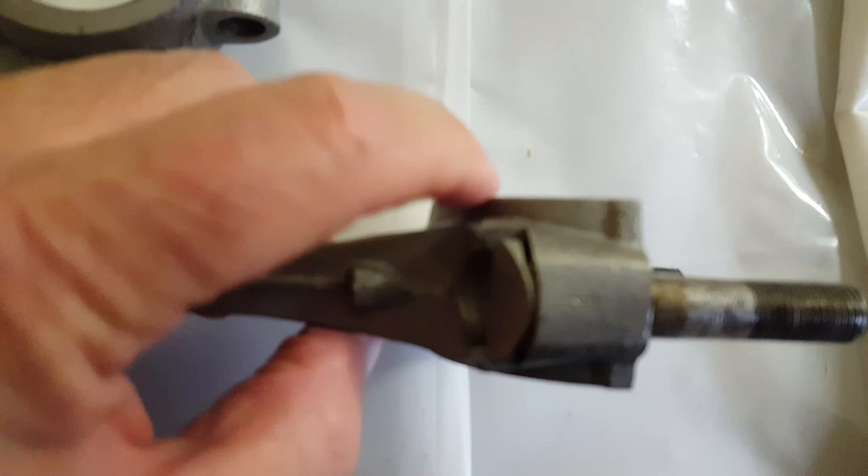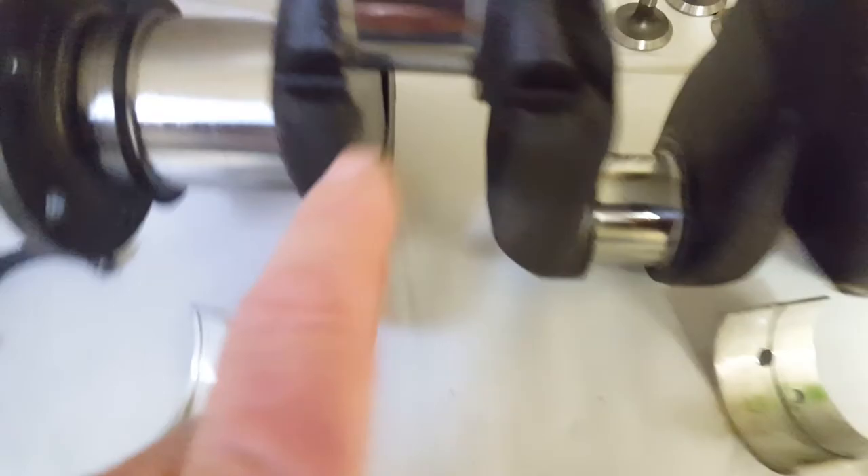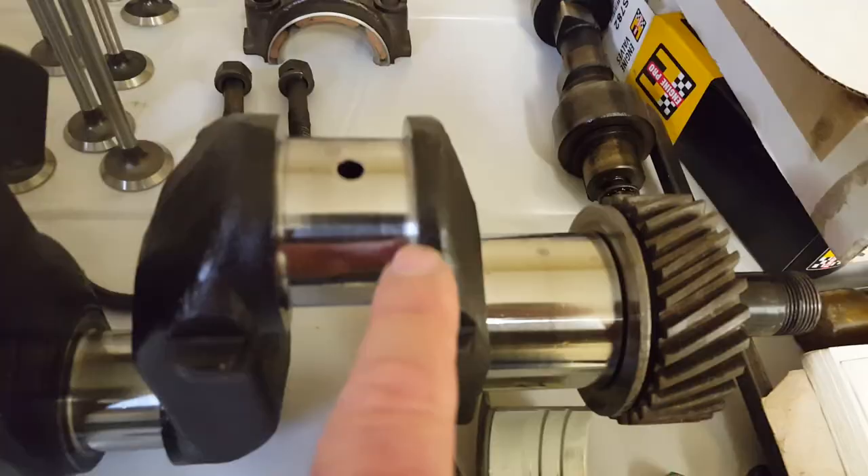See how you have a narrow side and a big shoulder on the rod bearing — the narrow side goes towards the nearest main bearing. In the engine you would have your three mains, so the narrow side should be over here on this one, and over here on this one, and then the last one up here. So the narrow part goes towards the nearest main bearing.